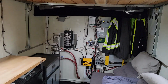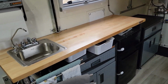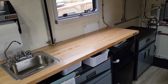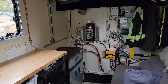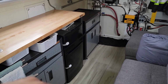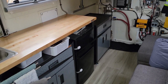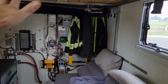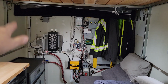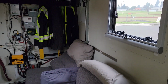So if you're thinking about building out an S280 or an S680 or an S580 or whatever version of the box you have, this is the winterized one that was on a cell phone repeater site. I won't get into that. You can go way back in the beginning of the build series and see how I came up with this. But radiant floor heat is a big game changer in these shelters, and it's so nice to step down in the morning to a nice warm floor. We've got a plate exchanger for the shower and everything, so it just kind of kills everything with one modification. You've got your engine block being heated, so when you get in the cab, you turn the heat on, you have heat right away. Anyhow, yeah, that works out great.